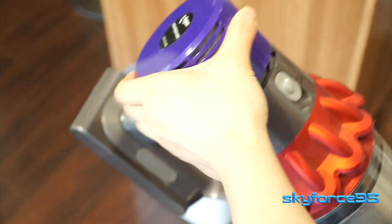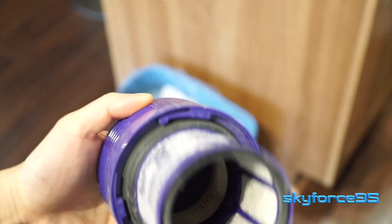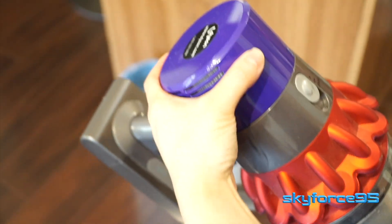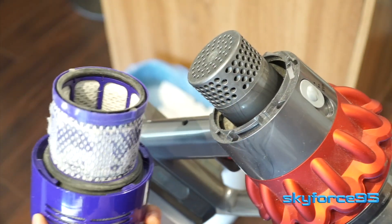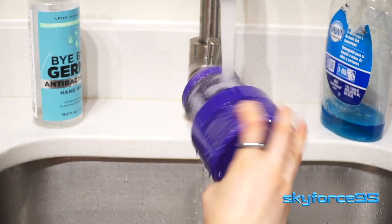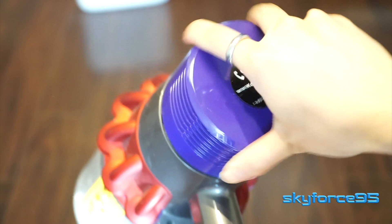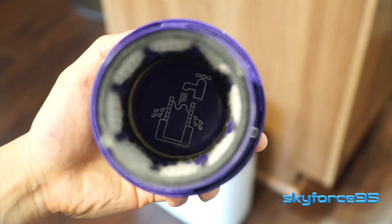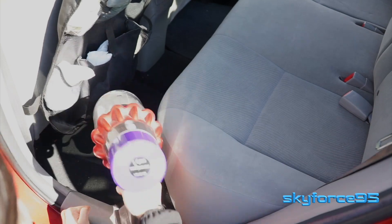In terms of maintenance there really is very little. There is a washable filter that you'll want to clean every once in a while — it does get clogged up pretty easily, so if you want maximum suction power you'll want to check on it by removing the lid by unscrewing it at the top. Since it's a washable filter you just rinse it out in water, let it air dry, and wait for it to be completely dry before reinserting. From my experience it takes more than just overnight if you don't put it in a sunlit or high-airflow area — it will not work properly with a wet filter.